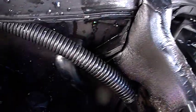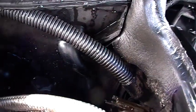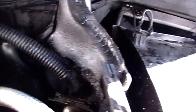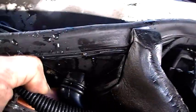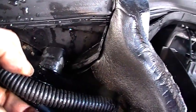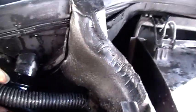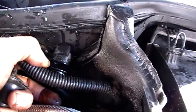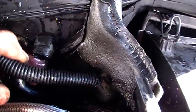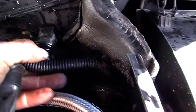My fear is that - and from what I've spoken to Dave about at MBZ - this is the one that does block up against the design flaw. What you can do is just literally pull it off and it all flows out, and there's nothing too significant but obviously it's not ideal. What some people do is take the actual drain tube off and put a little hose pipe on there with a cable clip, and just run it down alongside without the kink, which might be advisable to do.